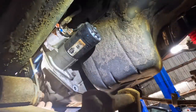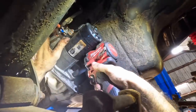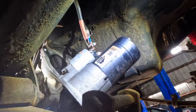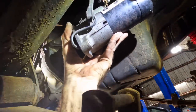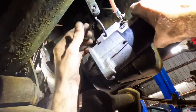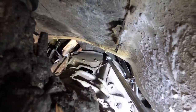One bolt is done, second bolt coming out, and our starter is free. I'm going to hang this with a bungee — I don't want that thing dangling by its wires. Now it's dangling by a bungee and by its wires — that'll work. We're on top of the transmission now, looking way high up at the top of the bell housing and they've got Torx bolts up there. Let's see if we can't get those guys out with an extension. I don't know why they put Torx bolts in there — they might be the only two on this truck.